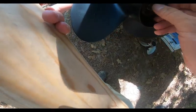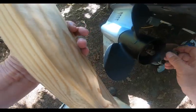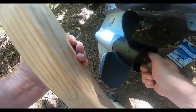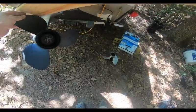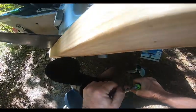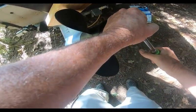Find the hole on the shaft — there's our hole right here, so the cotter pin will go through there. Use an old block of wood to hold the blade and tighten it down. We're going to torque it to 45 to 50 foot-pounds — snug and a little more. I think that's about right.